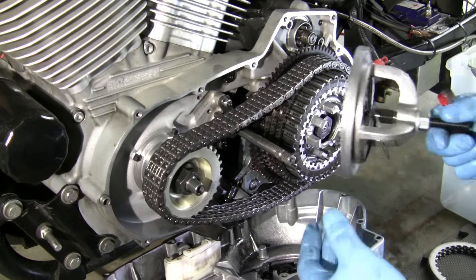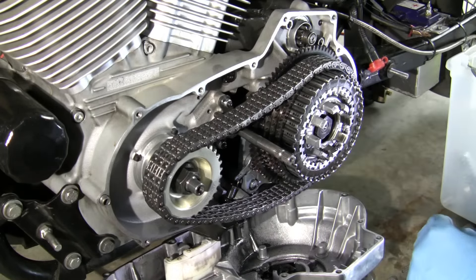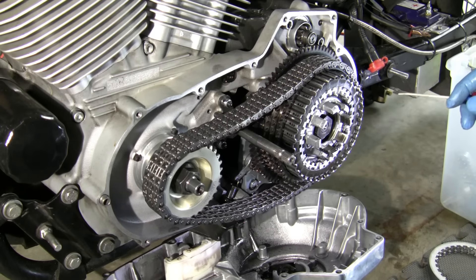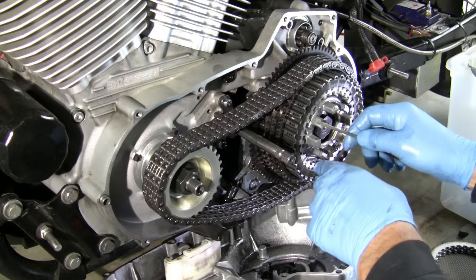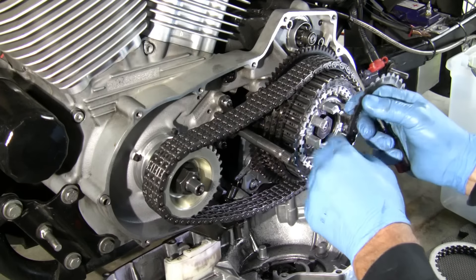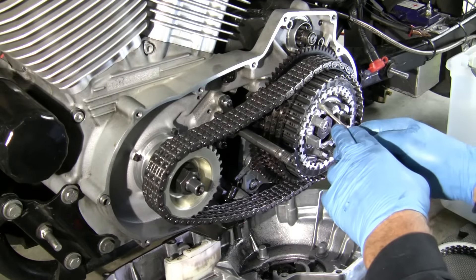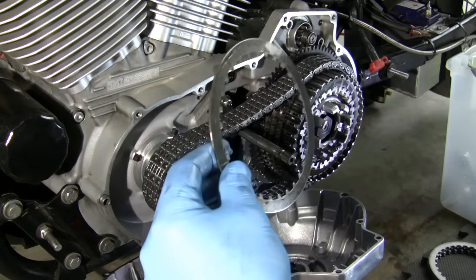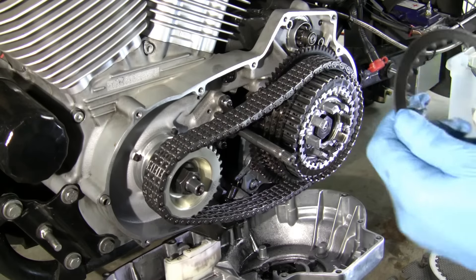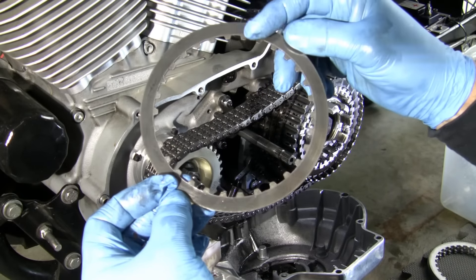After the clip has come out, you can pull the spring off, and there's the main pressure plate. I've got a box here — when I'm working I usually put my parts in a box. Now we have access to the plates and the fibers. I already had this Energy One extra plate clutch in there, so I'm just going to start removing it. There's one of the fibers — fiber looks good. But as I'm looking at this plate, I'm noticing some bluing on it, not real bad, but some.